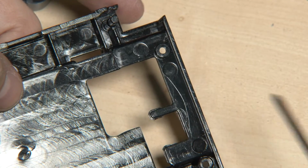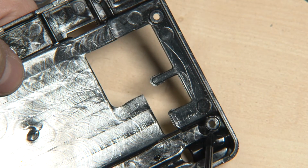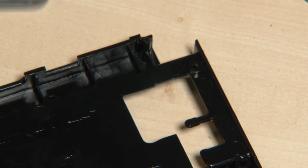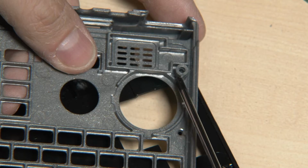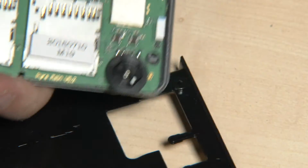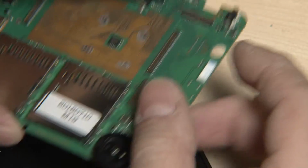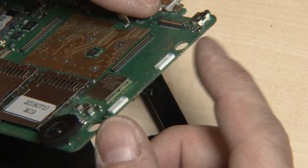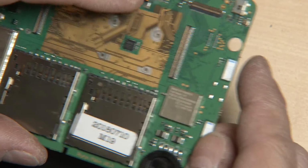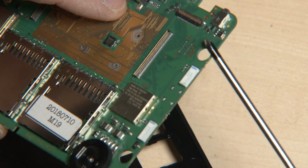Now the second step is to find out the proper height for these ones. Basically it's pretty simple. As said, we've got 1 millimeter for the supporting pegs here. Then you know exactly where the PCB is going to sit. Then the PCB also has an exact thickness. You can measure it, but I think it should be 1 millimeter or 1.2 millimeters, something like that. I forgot which the standard is, but I can ask. So it's 1 millimeter.